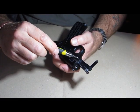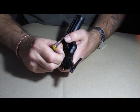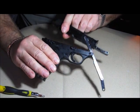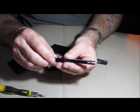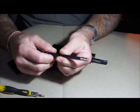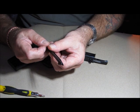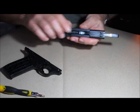Now there are two more little Phillips screws at the front, very short stubby screws, one each side. Then the top bit should just lift off. You'll notice something sort of fell out — one side came off — don't worry, that is how it should be. That's the bit that pushes up and catches — it pushes the piston back basically. Again, this didn't have much grease on it, so I'll put a little grease on when I put it back together.